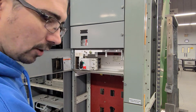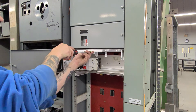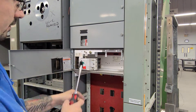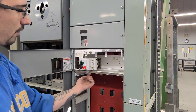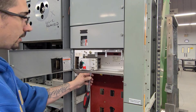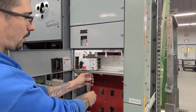Give that a good slam — that sound tells me we're in. I then take this and go clockwise, which keeps that in there. That's just a large pin that's basically locking up inside the divider pan. There's a little slot right here on the divider pan, and the pin goes through it. You can see my screwdriver popping through, sort of mimicking what that pin is doing — that just keeps the bucket from coming out.